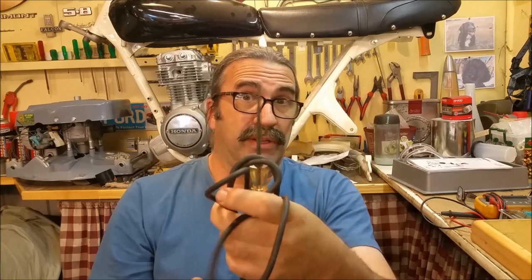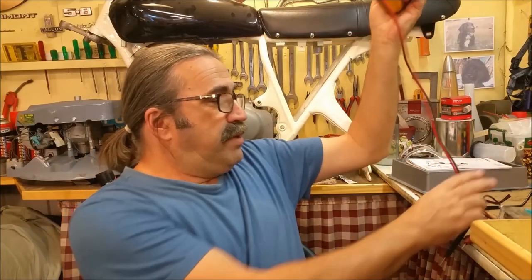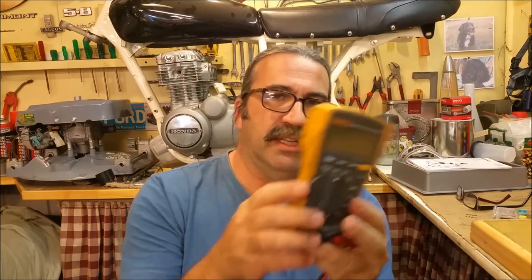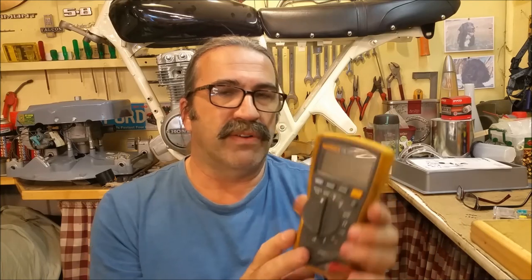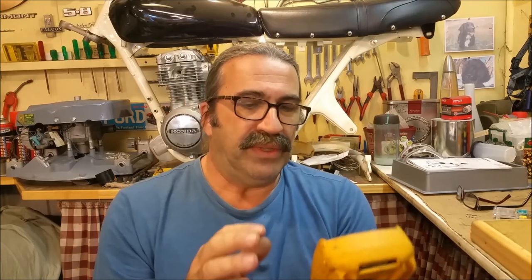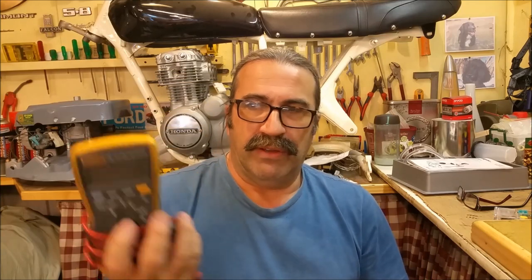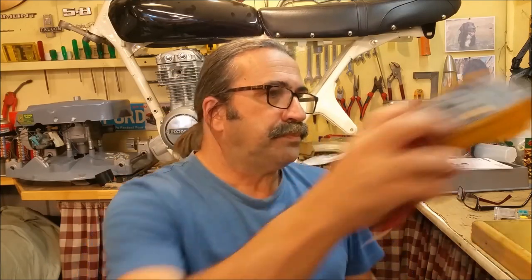But I actually tend not to use this that much. It's a very good tool, and when I need it, I need it. But most of the go-to stuff for me involves a multimeter. I always use this, particularly for continuity, for resistance, for voltages, all that sort of stuff. If you're doing a diagnosis on a VCR or something, and I'm showing my age, you would go to that, because you're not going to just get a 12-volt test light, because you don't know what the voltage is going to be. So a multimeter is the way to go for most of the stuff I do.